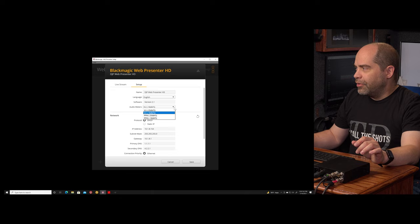You're only able to use one connection at a time. Fortunately it does have the capability of automatically failing over from one to the other — so if your ethernet connection goes down, you can fail over to a connected cell phone. In testing I also found that my USB modem — an LTE device — works as well. All I need is a USB-C to USB-A adapter cable, plug it in, and the internet connection worked just fine. You don't have to tie up a cell phone if you have one of these USB modems.